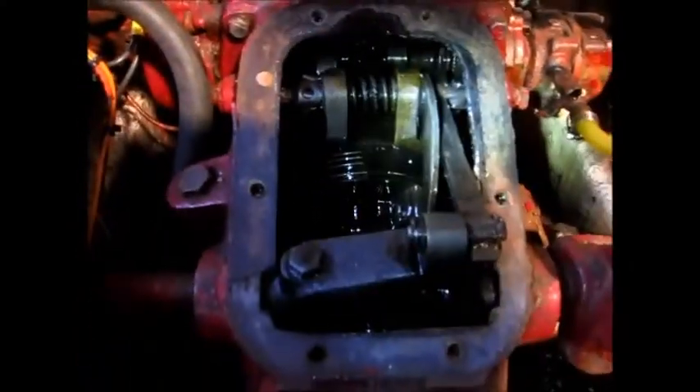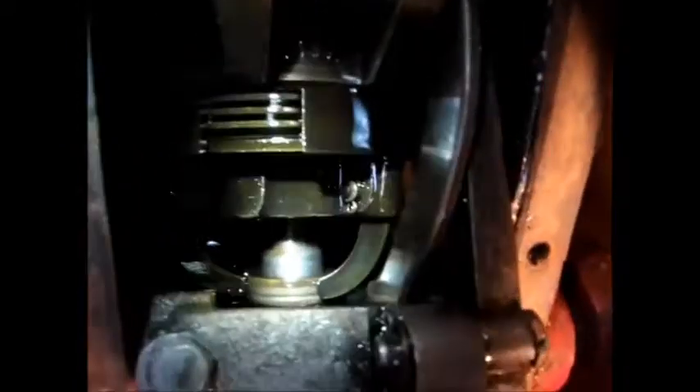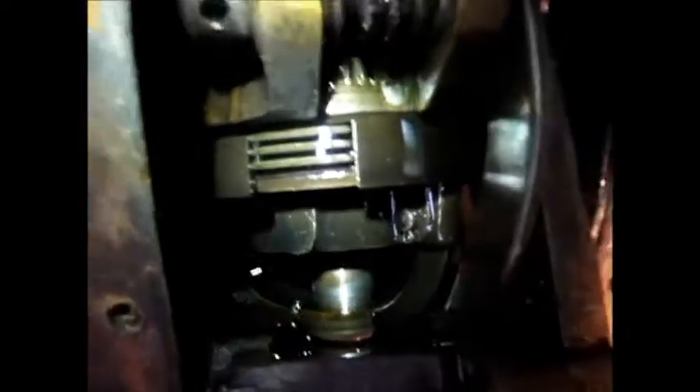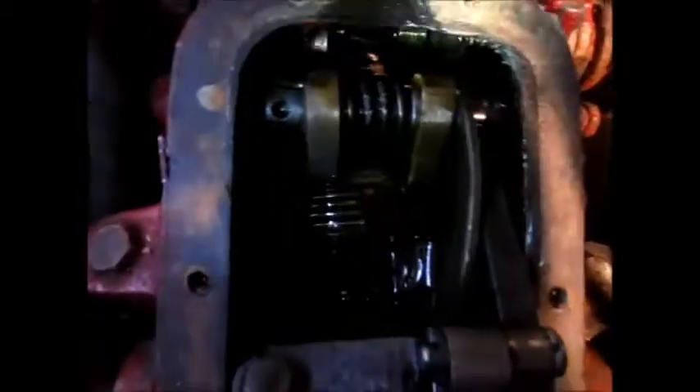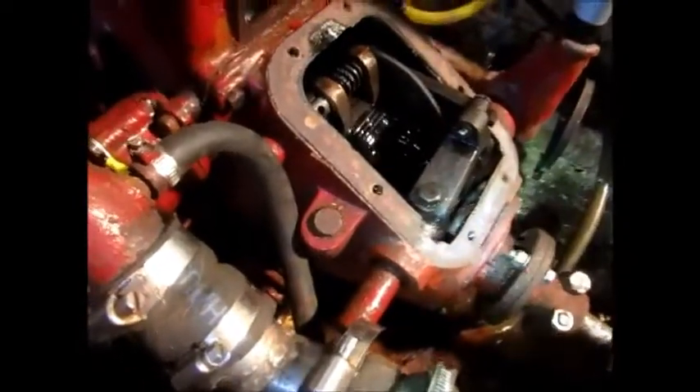If I push it into forward, which goes quite heavy, there's this little assembly of three arms that comes forward. That pushes the clutch in, so now there's a one-to-one connection with the crankshaft. And if I turn it over, you can see the whole thing moving.